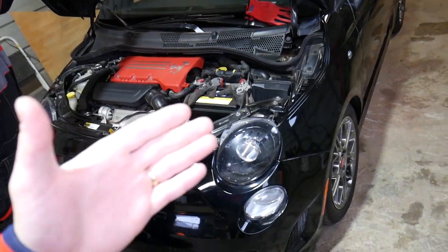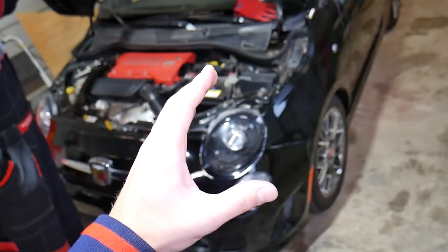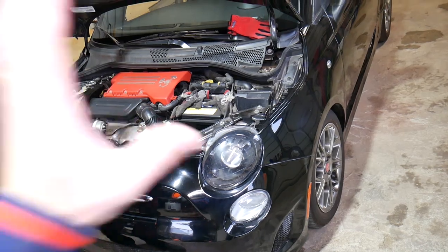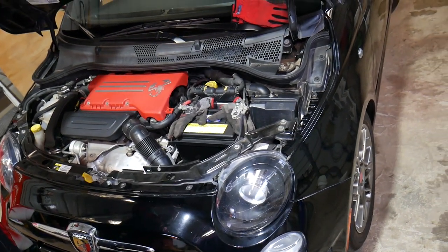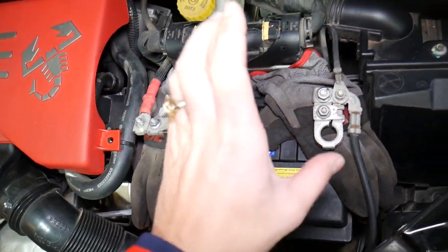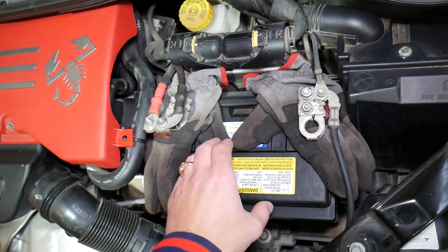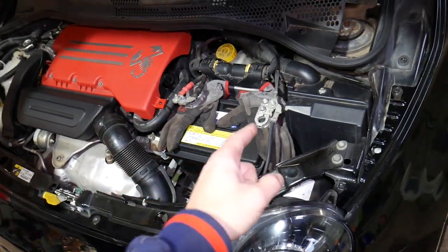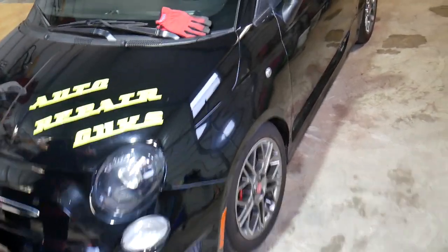Every time you disconnect an airbag, you need to make sure that you disconnect your car battery for at least one hour before you start working on the airbag. That way the system will discharge and the possibility for something to blow up is less likely. If you're not qualified and certified to work on airbags, don't do it. There is a special way to disconnect your car battery so you don't cause any damage to the electronics or engine computer — we'll have a link in the description. It matters whether you remove the positive or negative first, and it's also very important how you reconnect it later.